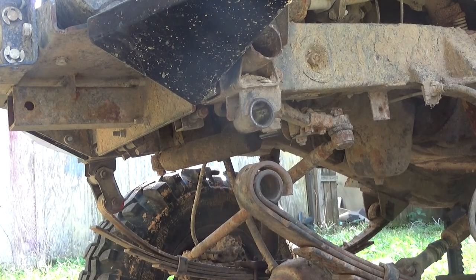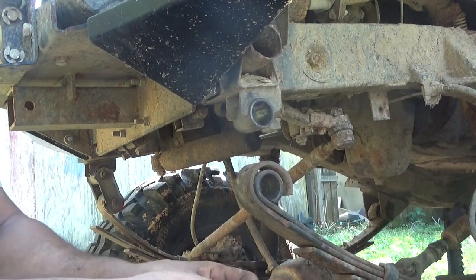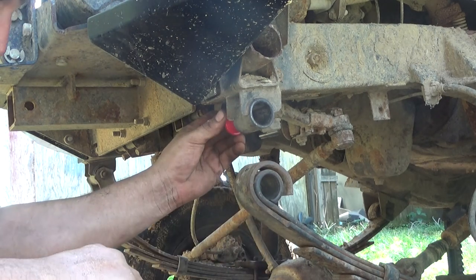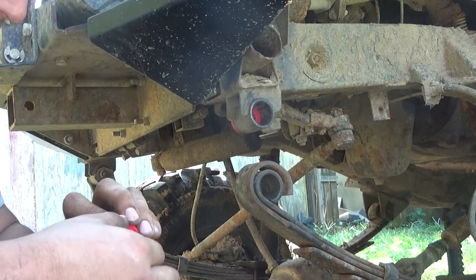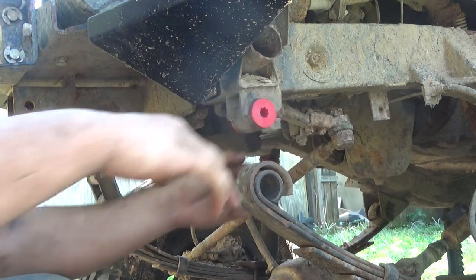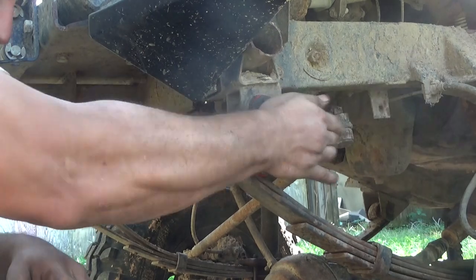Let's go ahead and do this side. Same thing — clean the inside. After wiping the two holes out with the rag, I'm about to put the bushings in and applying a light coat of grease around the bushing. These you should be able to just push in by hand. Now it's time to put the shackle in. Same thing — grease on the two pins and you need to have the suspension set up where you can just push it right in.